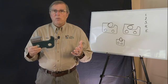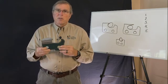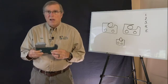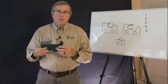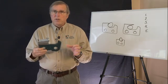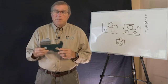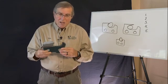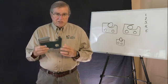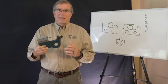So how do you know when it's sharp or dull? Two ways. The first one is you could look at the chips. A lot of people talk about that, the sawdust. If you're getting fine powder, most likely your saw is dull and you're pushing on it. If you get a good chip, that's great, kind of the distance between two cutter teeth. And if you go to the end of a log, you can pull out longer chips. I always tell people it's not the size of the chip that makes the difference, but how fast it cuts.